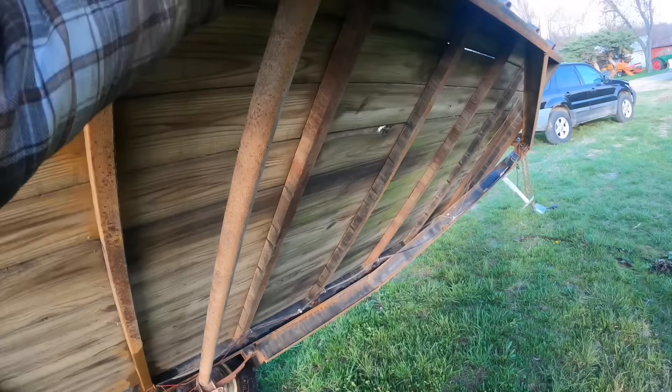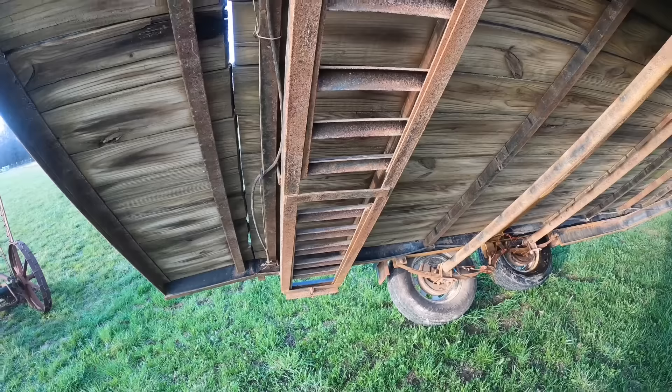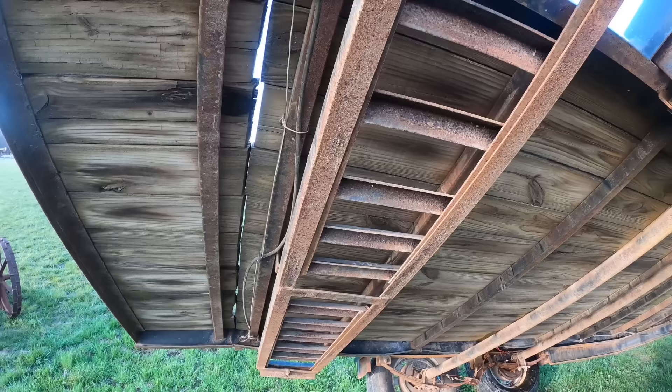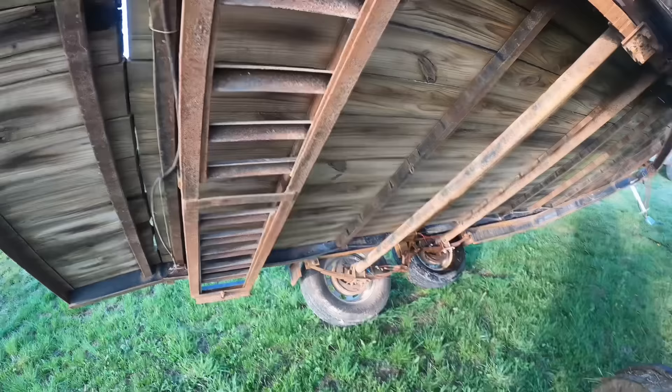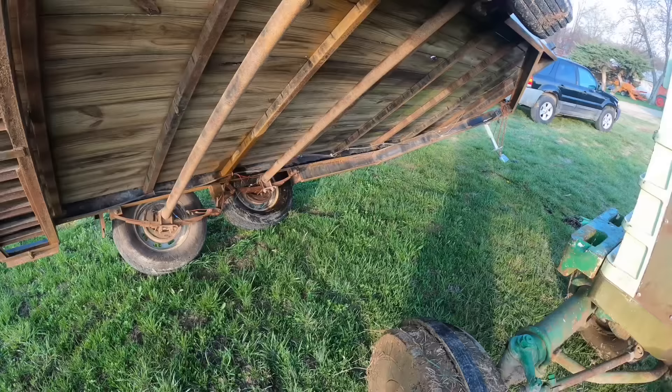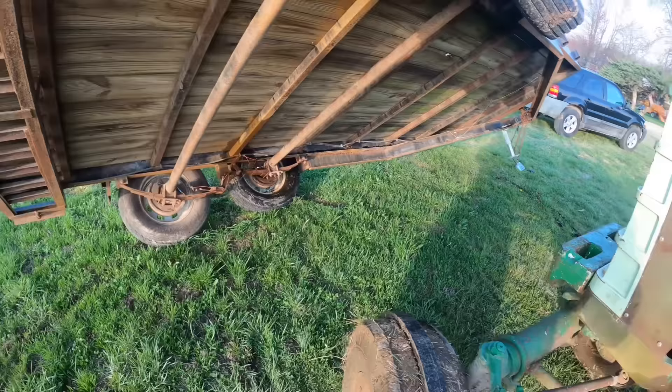Now that I've got mud all over me — great. I thought we were going to have something fairly easy, but that's not going to happen here. We're just going to cut it all off and start over. We need some seven-strand trailer wire at least from the front of the trailer to the brakes, and then regular trailer light wire for the rest of the back to the lights. This is going to be a lot more difficult than I thought.